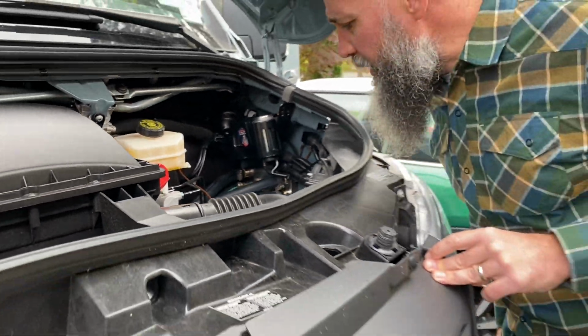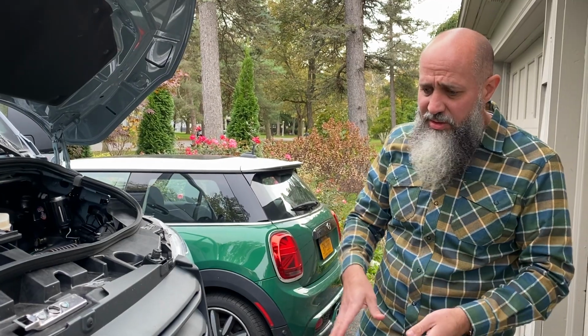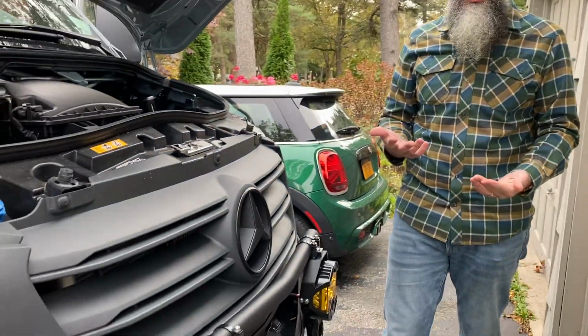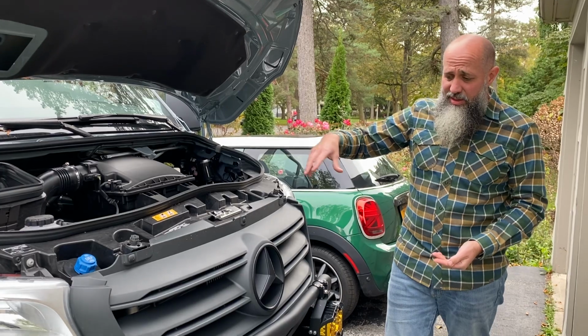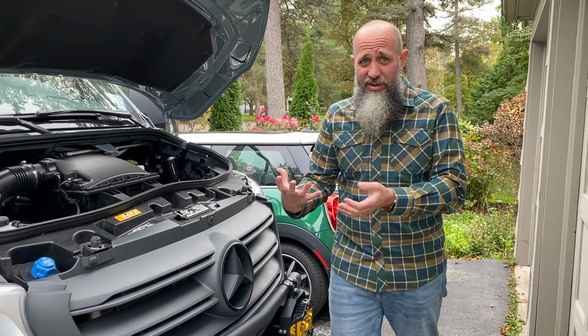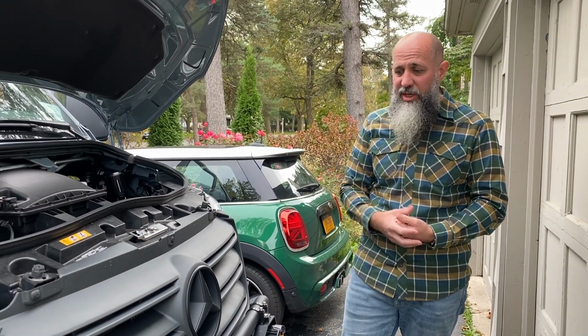So really nothing else here except for all the wiring for the LP6s and everything else. The winch was super easy to wire, probably the easiest thing I wired on this whole project. Basically, the black wire goes to ground and the red wire goes to the starter, so you just connect it right on there and tidy up your wires. Really easy install when it comes to wiring the winch.